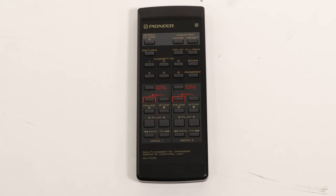Another fancy addition to the system is the remote control. Most of the buttons on here are also on the front panel, but there are three additional buttons: all rewind, scan, and random. All rewind will rewind all tapes in deck one to the beginning. Scan will play the first ten seconds of each tape — good for checking what you have loaded. The random button is the best feature of the entire device. When random play is turned on, the 77 will randomly play music from deck one — specifically it will randomly select a tape, then randomly select a track from that tape, repeating this process after each track ends. It selects tracks by detecting blank spots on the tape. This is very impressive.